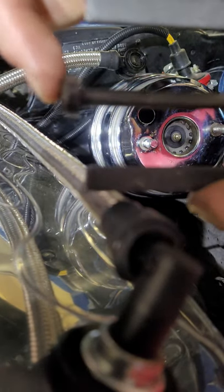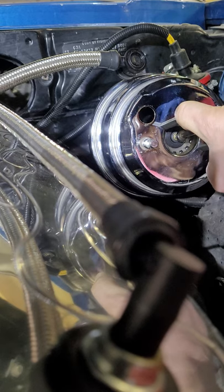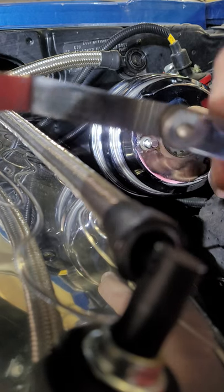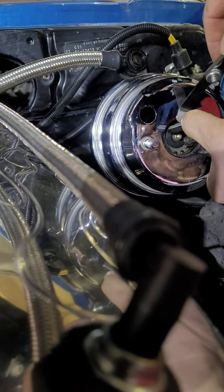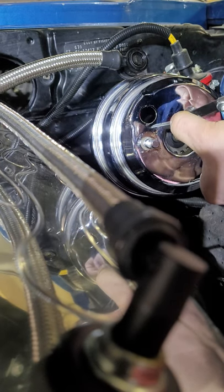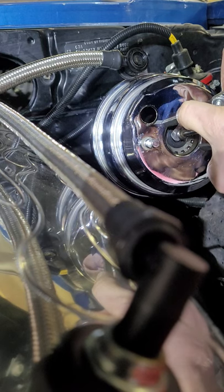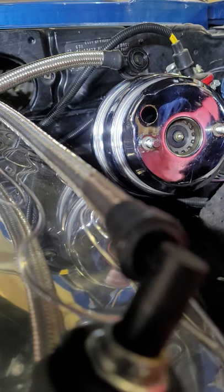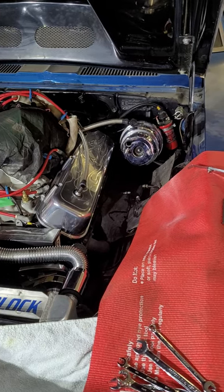Take this end of the tool, set it up in there, and make sure it touches the housing of the booster. Then take a feeler gauge - 0.020 of an inch. The angled ones work better so you can actually get in there, because you're going in behind the housing. Make sure you line up that pin and slide it in there. As you can see it's snug - that's what you want for clearance. That gives you enough pedal free play to make sure you're not hanging up on your brakes, so when you release the brake the master cylinder is actually releasing 100% of the pressure. That's how it's done - hit like and subscribe!